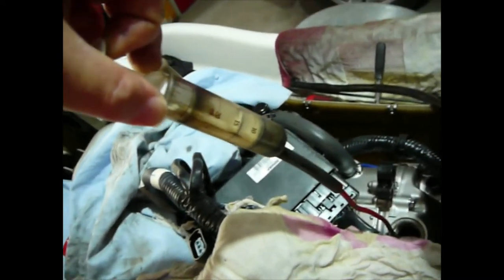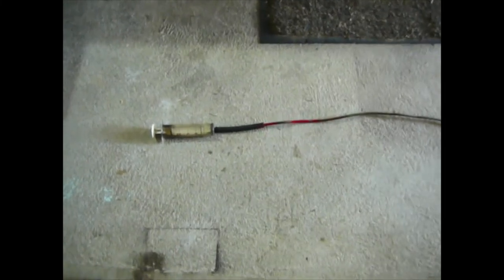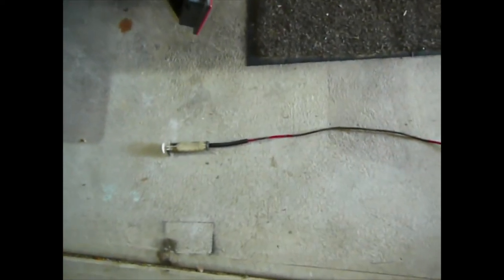It's difficult to do with one hand, so I'll stop here now, but at least you get an idea of what's involved. You can pull the syringe off the end of the tube and keep going backwards and forwards until you're getting no more oil sucking up, then start at the back of the motor. The syringe is hooked into the equivalent of a vacuum hose or washer bottle hose for cars, then into the brake line equivalent. You just do approximate bends to make it work, particularly for the front section of the motor.